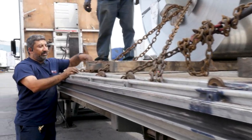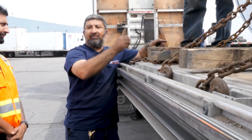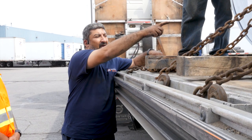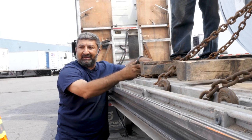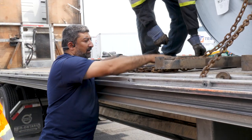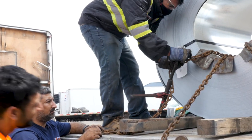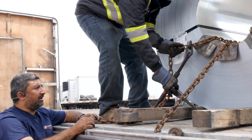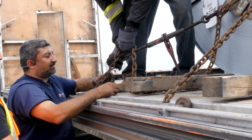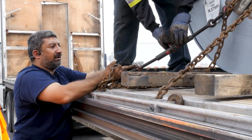Always open the binders all the way. When you open the binders all the way, you have more movement to play with — if you keep it closed and start pulling, it will get shortened and you'll have to release and open it back up. Navinjo is going to show you how to do it. He's going to clip the top first, right in the hook, and then the bottom. Go as far and as tight as you can so you don't have to do it again.